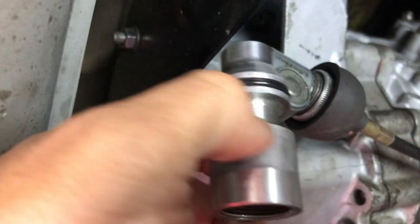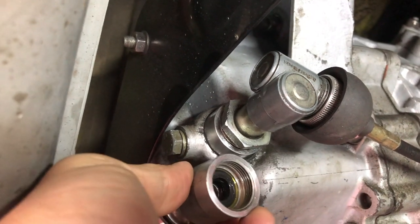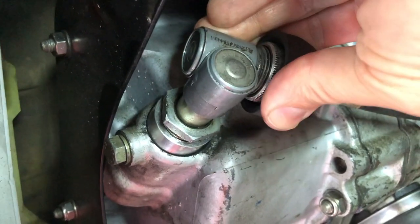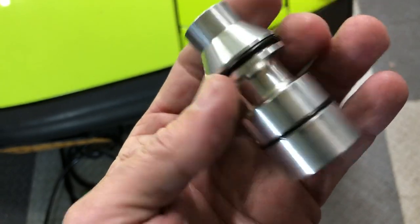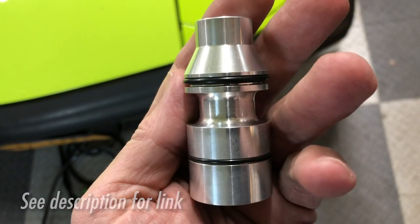There are a few reasons why the speedometer drive gear leaks. In the original design the single O-ring sits pretty high up in the bore, and that combined with movement and vibration over time degrades the O-ring and the inner seal, which allows gear oil to seep past. You can either refurbish the factory drive gear with a new O-ring and seal, or upgrade to an improved design with two O-rings like this one from 914 Rubber. While you can change the speedometer drive without dumping the gear oil, it's way better and safer to just drain the case.